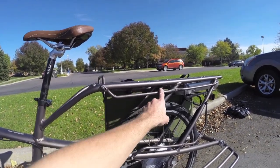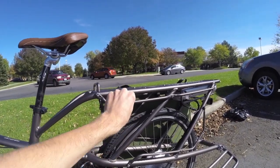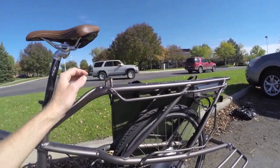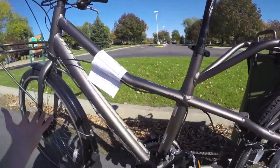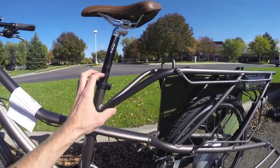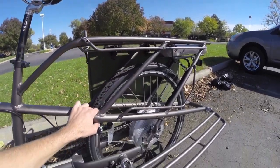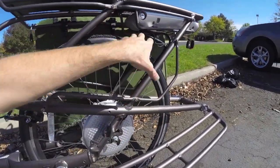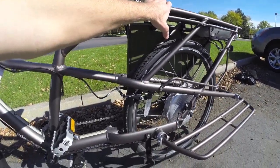There are bosses all around here, and you'll notice this extra rail added to the frame that's a standard gauge tubing for adding panniers. That's really cool because the thicker gauge tubing — reinforced, TIG-welded aluminum throughout the frame — it's a little bit sturdier but it won't work as well for panniers, so they've done a good job thinking through different design elements. You can see where you can bungee down or tie stuff on — it's a really nice frame in a lot of ways.